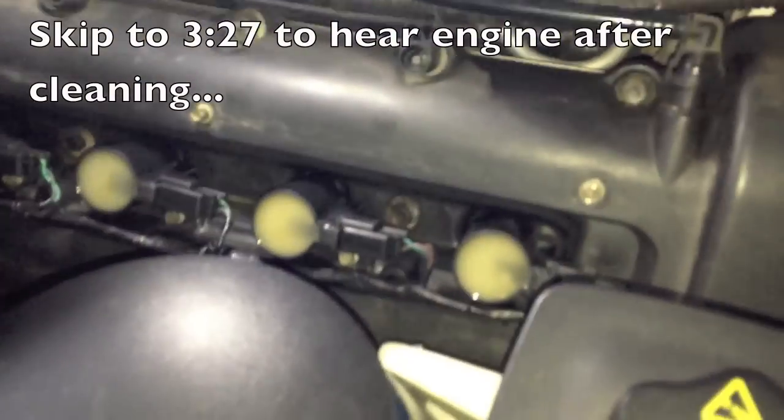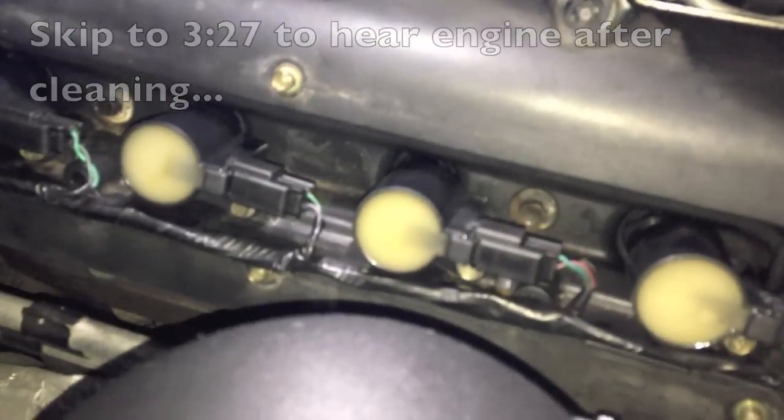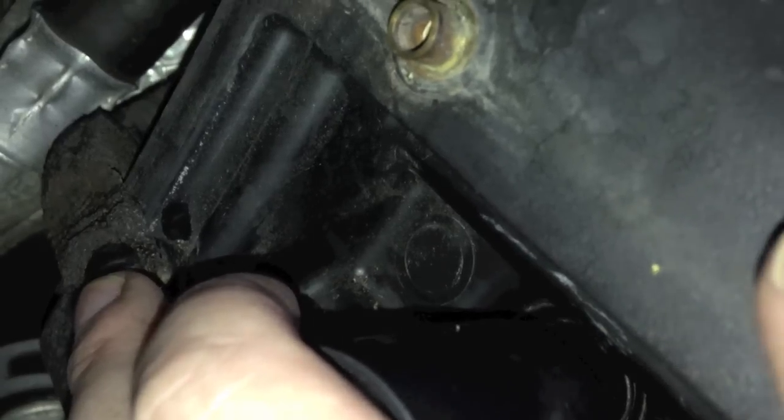I'm putting everything back together. All the spark plugs are in their place, they're cleaned off, all the coil packs are cleaned off. I'll get as much water out of these wells as possible. Now when I'm putting this back together, I noticed over here — this is the cable that connects all the cabling to the coil packs — notice how there's a dip right there. That might be one place of failure, or water possibly getting in. I don't think that little foam there is doing much of a job of holding water out.